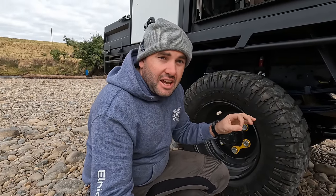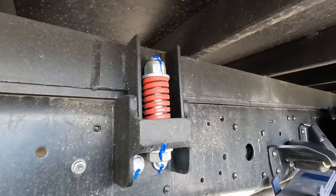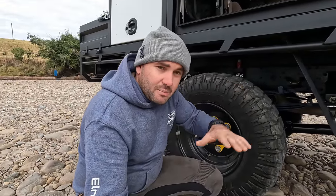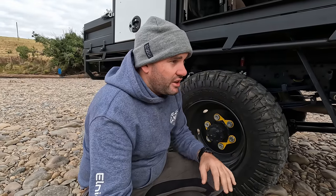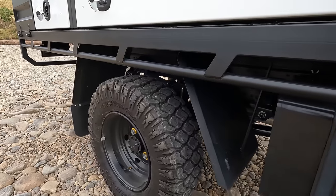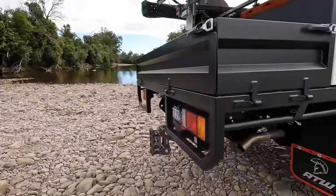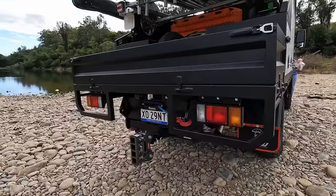Now for the tray. This tray was built by RSK Welding in Wollongong and it's actually a spring-mount tray. These trucks' chassis flex a lot more than a normal car, and the spring mount lets the tray and chassis move independently, reducing fatigue, cracking and all that. It's a three-and-a-half metre steel tray — we went steel just for the strength, and we have plenty of weight capacity.